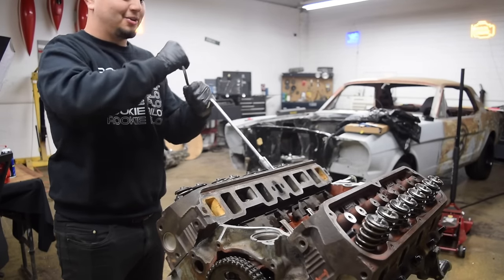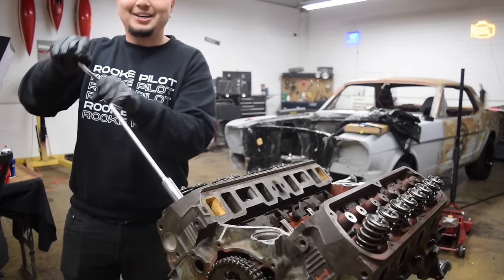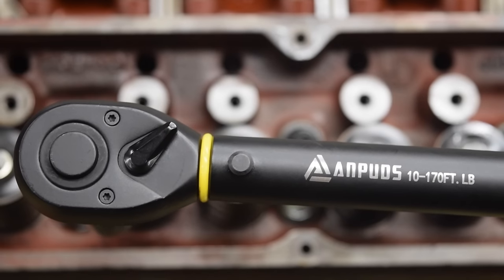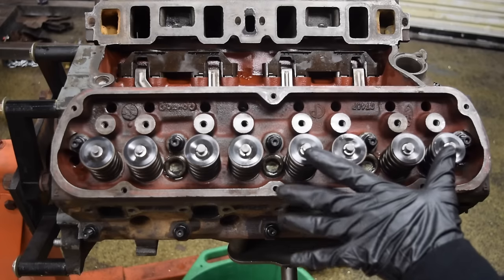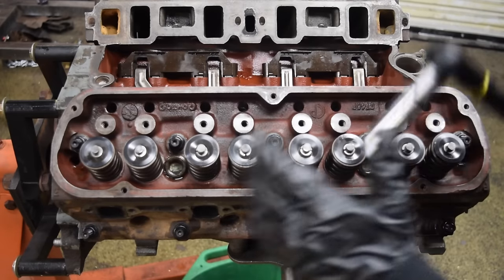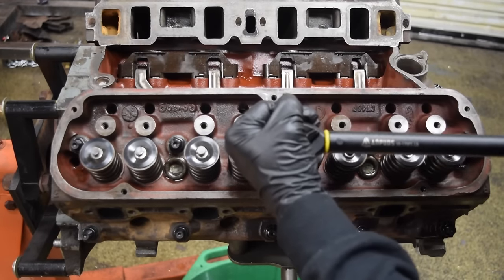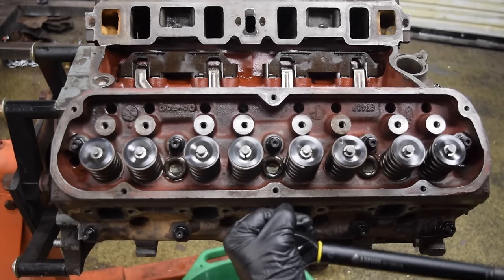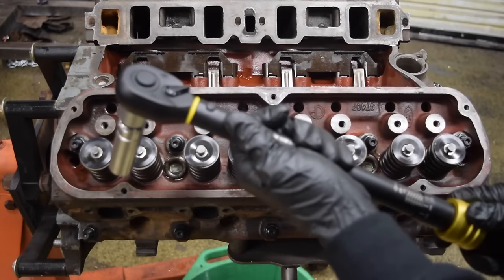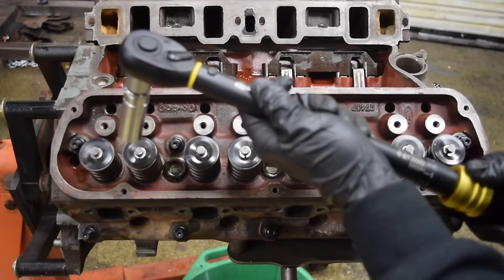I just got this tool at a yard sale like 30 minutes ago — I saw it and I was like, I gotta have it. Makes me feel like an old hot rodder. I'm not torquing these down at all, just making them seat so then we can hit them with a torque wrench. Today we're going to be using the torque wrench. The regular head bolts would get torqued down to 70 foot pounds whereas the ARP head studs have to go up to 80 foot pounds. We're going to do this in three stages: 50, then 65, and then 80, following the proper torque sequence starting with the middle. Round to 50 is done, let's move to 65 — and our final rating of 80.